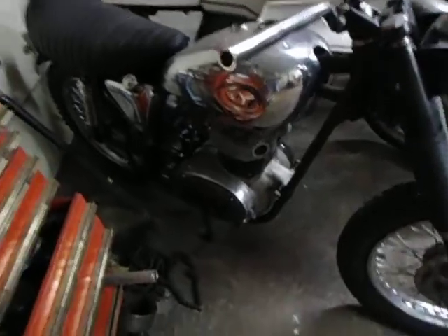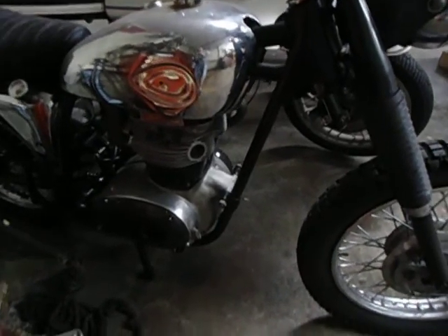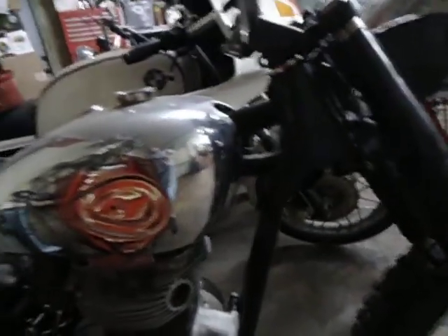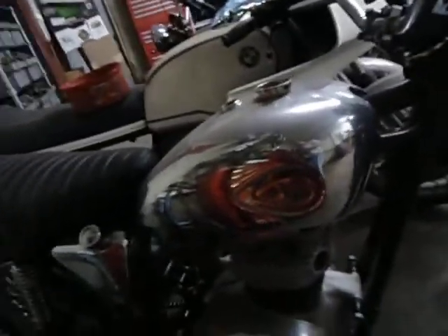Here in my workshop, we'll start with this unfinished project. The engine has been entirely gone through, built right up from the bare crank with the sludge trap cleaned. It's going to be a nice little street tracker or street scrambler. It has a very unique thunderbolt head modified for twin carburetors, beautifully ported, set up for 32mm carbs, with higher compression pistons — I believe nine and a half or ten to one — a low gear ratio, and all the makings of a nice little street scrambler.